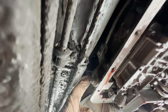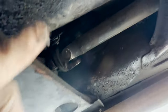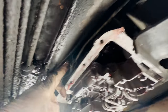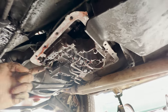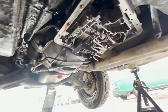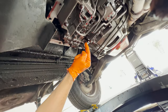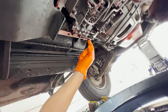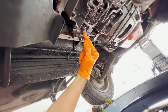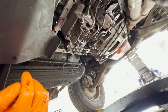And then the gear shift linkage comes up from the top here, and it goes all along the side, and there's a couple of bushings in there that you can service. That goes to this rod. I'm trying not to get in the line of hydraulic fluid that's dripping here, but this rod here is what is attached by the linkage from the outside. And that goes through, and we could feel the detents of each gear as it moves the plunger to also change the hydraulic passageways.